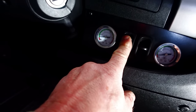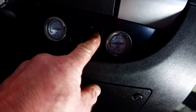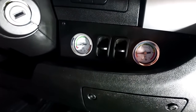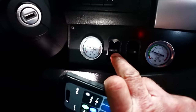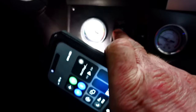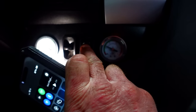Just take it up out of the red, and then I've got to get it down and get my jacks back out. So I'll get into the green for a minute and hold it there. Right, I'm just going to finish it off underneath and then get the jacks out, and then we should be pretty good to nearly go. So I've got the jack out, so I'm just pumping it up to 2 bar, 2.5 bar. Let's get them up to 2.5 bar each bag. There we go.